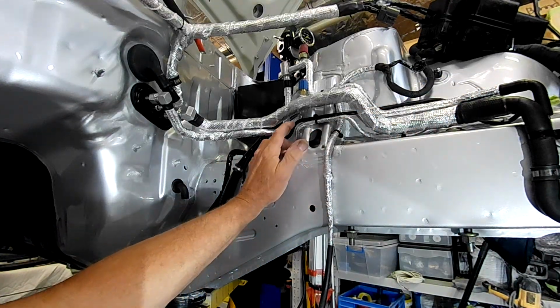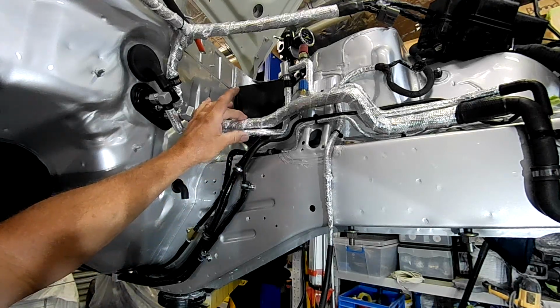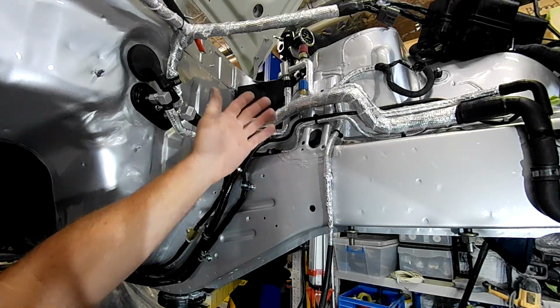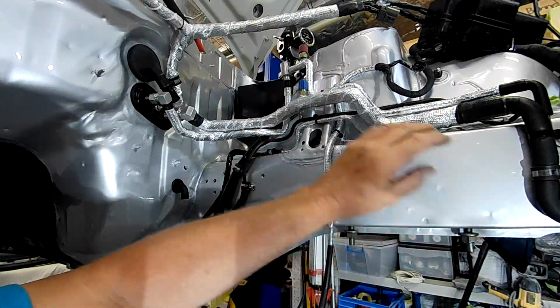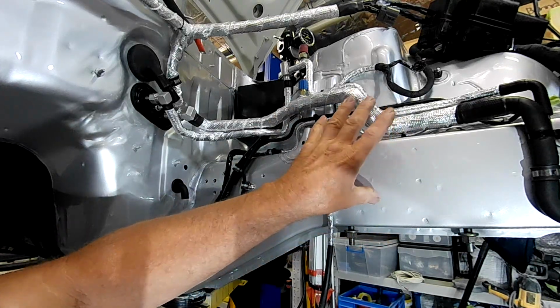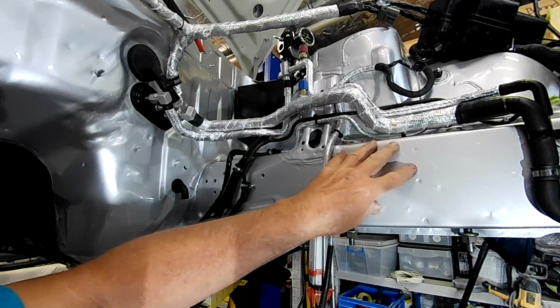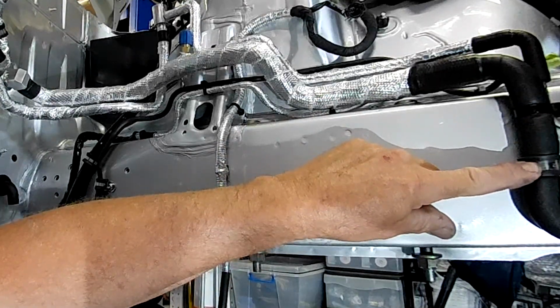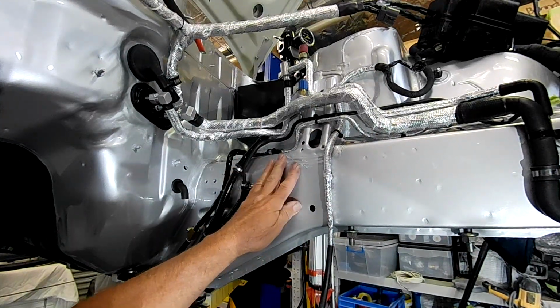Now up from there again, this first one here, these are our two AC lines that we did. You can see how they've turned out. They look absolutely fantastic, and they mount all the way. Everything's mounted really solid, as you can see. Original bracketry has been used where possible, and on occasions I've been using stainless rubber line P-clamps in areas where things are a bit custom.